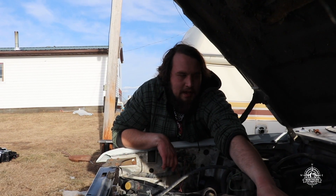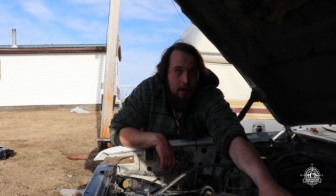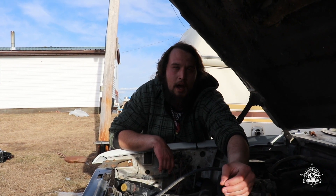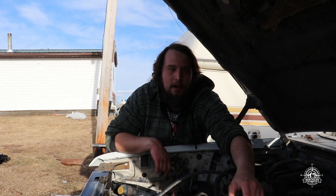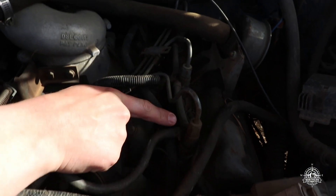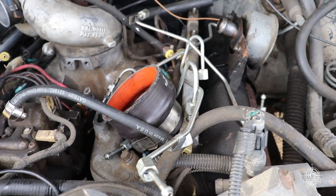On these IDIs, there are little plastic caps on each injector with little rubber O-rings underneath. They'll dry up and let air into the system, which can cause long start times, hard starts, or no starts. The best way to fix that air intrusion is these R&D billet aluminum rails. A little bit of a pain to install, but they blow those plastic caps out of the water.